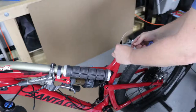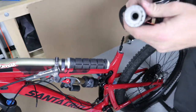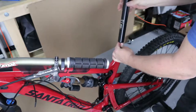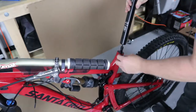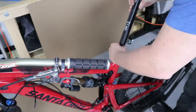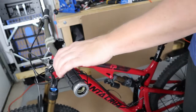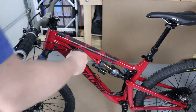The most important thing is to get the pinch screws all the way in, because this piece fits inside the dropper post and anything sticking out will create resistance and prevent it from going in. This piece threads into the bottom, and the cover threads onto the outer threads. Put the seat on, hold the connector, and thread the seat down until it stops, then pull the dust cover up and thread it on. To test: press the lever, push down — the seat should stay down — press it again and it comes back up. Then tighten your cable ties.